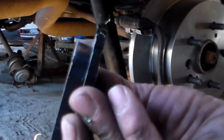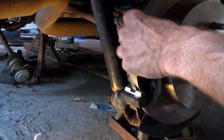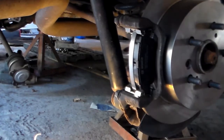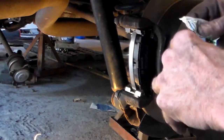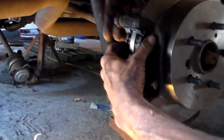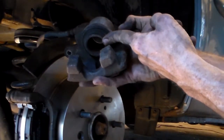Now I'm going to put one of our brake pads in — the outer ones are the same. I'm going to slide one of the outer ones in first: start at the bottom, push it straight down, then at the top give a little push forward and in it goes. Now there is a difference for the rear pad — put a little bit of grease on those edges, then we'll slide this one in from the back, same as putting the front pad in.